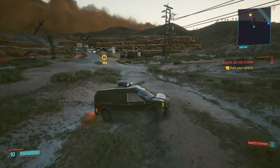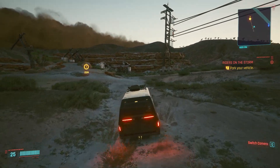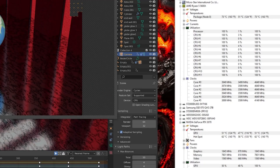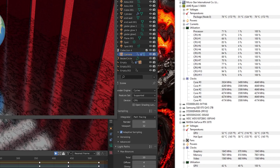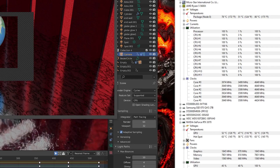Today though, it's only low 20 degrees and not low to mid 30s, which is roughly speaking the standard hardware test temperature. I fired up Blender this morning just to run a quick test before I decided if I wanted to do any more tests with this cooler, and as you can see, in an approximately 22 degree room, the Wraith Stealth is keeping the 5600X to 80 degrees while under 100% load for a few minutes.